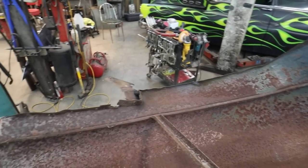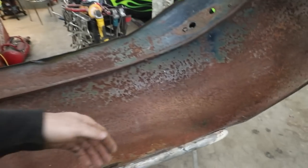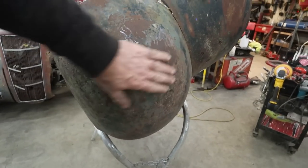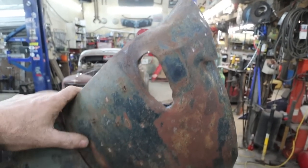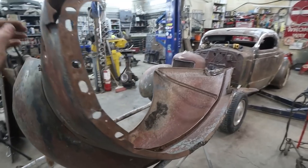Yeah, a lot of the basics. Weld up this, add some strapping, trim this some more. Weld up these few bits. We got to planish out the front of the fender. You can see some pretty big dents and stuff in there yet. Make this hole look normal and try to get this whole section of the fender to look normal. So we'll do a bit of hammer dolly, a little bit of planishing.